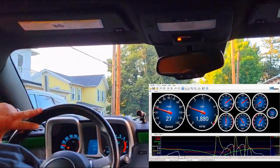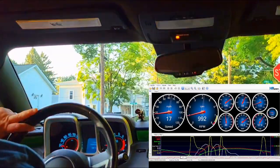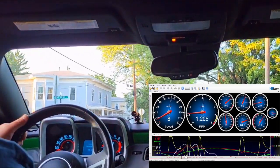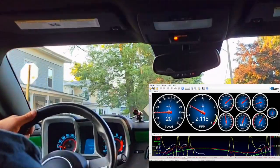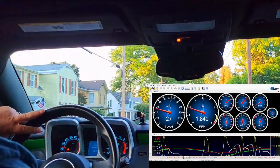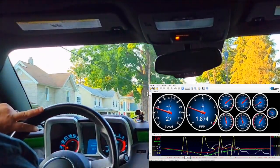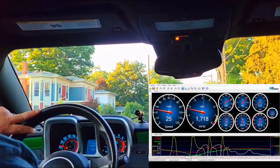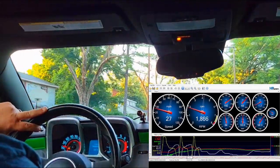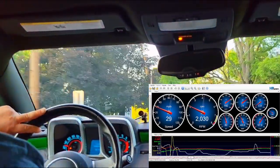Go ahead and turn the air on — it's pretty warm tonight. 73 degrees doesn't seem like it could be as warm as it is, but I'll put the windows up so you can hear. You can see we're moving along at a real modest RPM here. You can get it to buck a little bit if you get just out of the throttle where it wants to start decelerating — you can't really decide if we're coming or going. But we're really driving at too conservative of an RPM for our speed. Speed up just a little bit and you'll see it's smooth, and we can sit there comfortably.